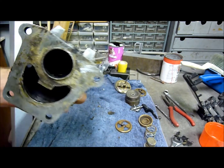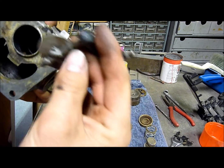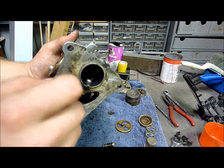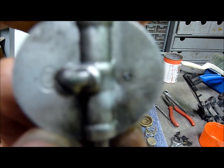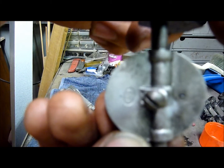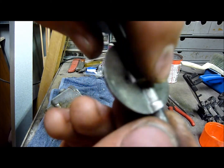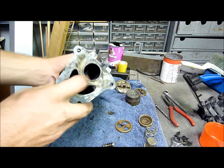And so when your throttle is fully closed, like so across there, it still gets air coming through that hole that's inside there. And you can also see a tiny little hole in the throttle lever just in there, if it'll focus, which it won't. No. Yeah, so that's where it gets its petrol coming through, just in there. So a slight bit of petrol, and you get your air coming through that little jet there.